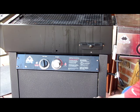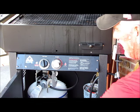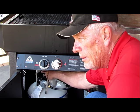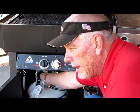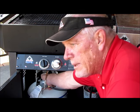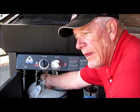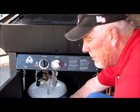So it's a very simple matter. Anytime you're working with gas, always raise the lid. All you do is simply turn your gas tank off and then uncouple the regulator from the tank. You might hear a little hiss when you do that — that's releasing pressure. Did you hear that? So just release it for a minute or so.